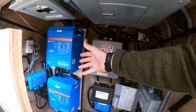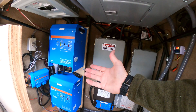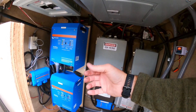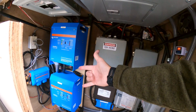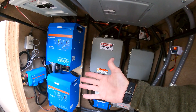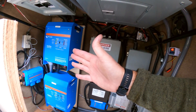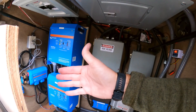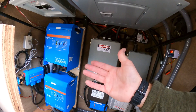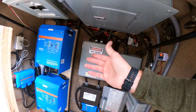If I unplug it, these immediately act like a UPS — so nothing inside knows it — but if I drop power it will immediately feed at least 3000 watts per panel. I can run two air conditioners off of my batteries at a time. While I'm driving down the road, the alternator charges it back up so I can continuously run it, and then I can run the generator as well.